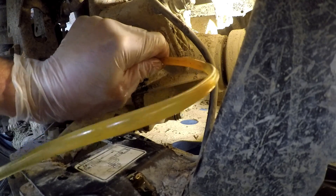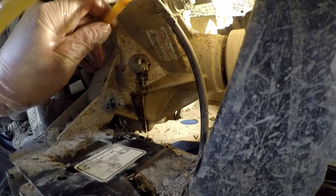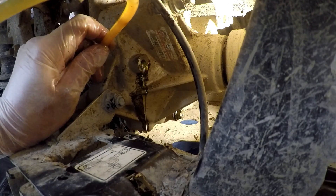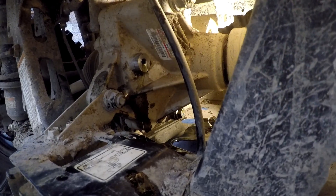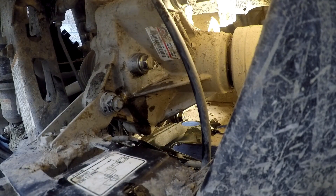I have to be getting close. Oops, I'd say we overfilled her a little bit. Now that I'm done for the most part making a big mess, I'll go ahead and reinstall our fill bolt up here, and it gets torqued down to 16 foot-pounds as well. And that's all there is for the back.